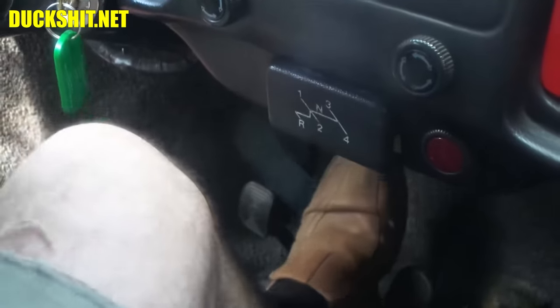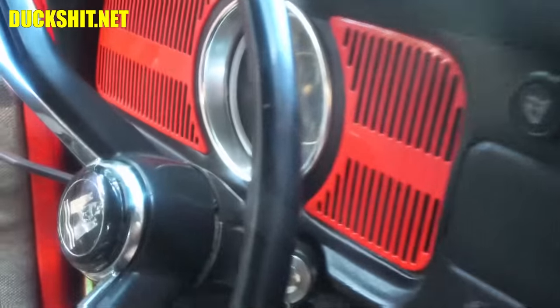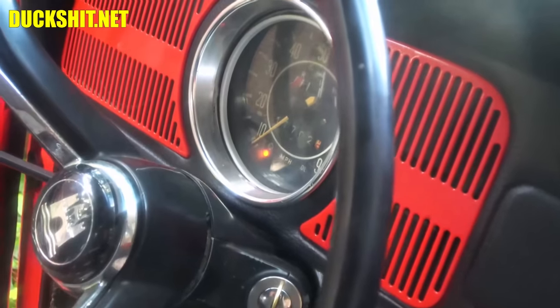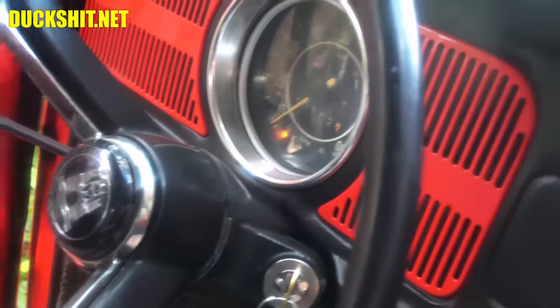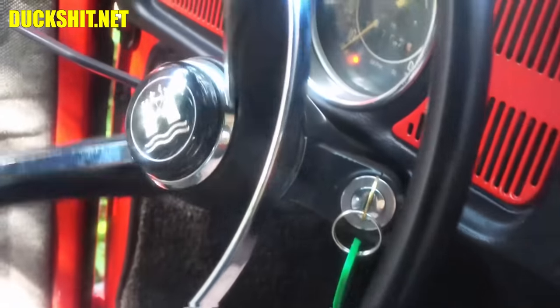I did see some stainless steel lines when I stuck my head underneath there, and that would be why. Oops. All right. That engine might need a little bit of work. I have to play with the fuel mixture screws and stuff at idle. Possibly even the idle screw. Oh, you'll have a horn. Well, I guess I'll look at that, too.